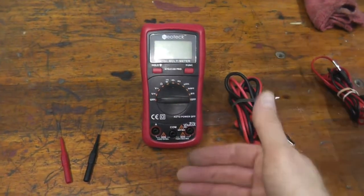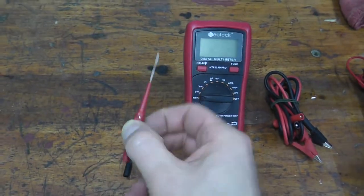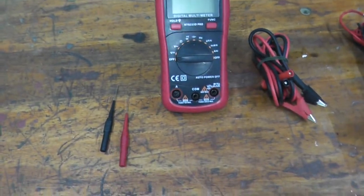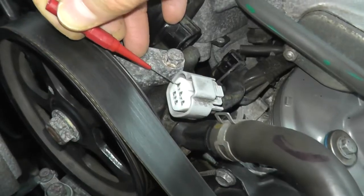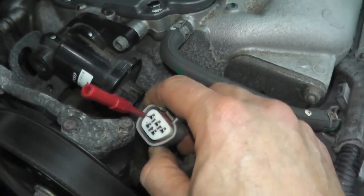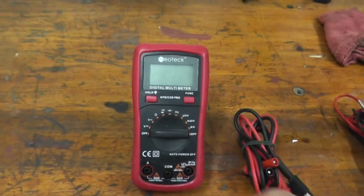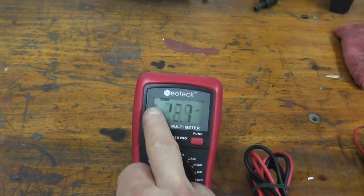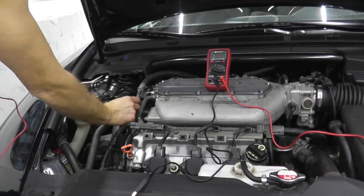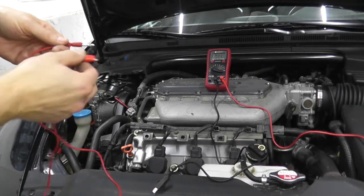It's very easy to use, and I'll have a link in the description box below in case you need any tools. This is just a probe kit. If you don't have one or don't want to invest in a probe kit, you can simply use a paper clip instead. The wonderful thing with these probe kits is that they won't damage the harness connector. If you are using a paper clip, just make sure it's thin enough because you don't want to damage the metal prongs inside the harness connector. With the multimeter, you want the volts DC setting. Take the red lead to the prong and black goes to ground — any good metal point on the vehicle.